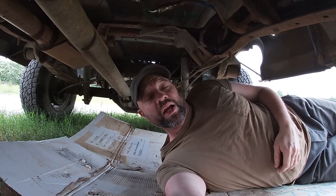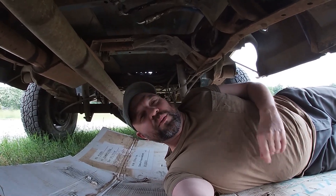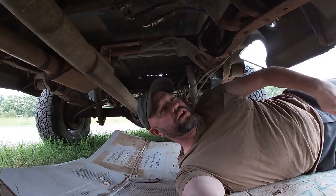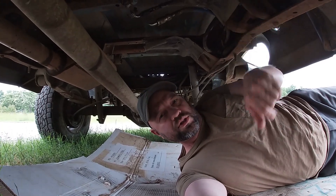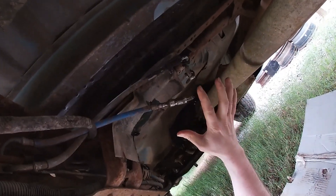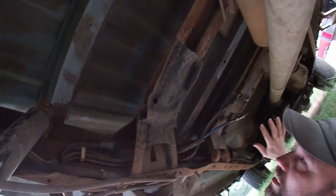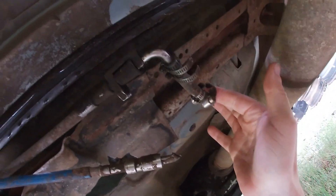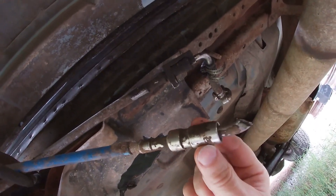Well hello there — probably wondering why I'm underneath the truck. Because I'm working on something. So I moved the truck over here to the grassy area, not on the gravel area. Swatting mosquitoes. I smelled fuel, so I came over here to look underneath just to make sure nothing weird went wrong with that fuel filter I put on. The front tank has been removed and this is the return line — it's just capped off, and that's what was leaking. This is also the fuel pump line right here.